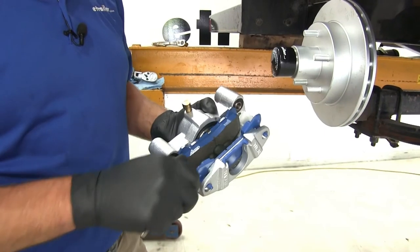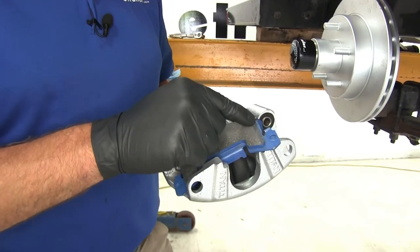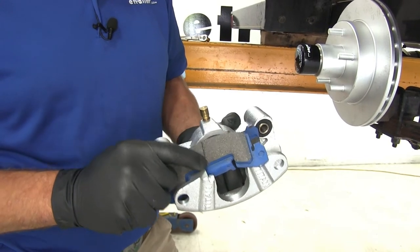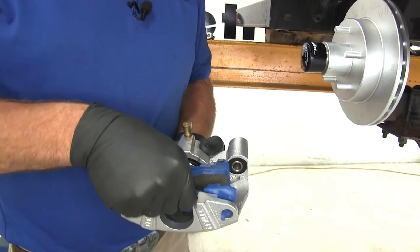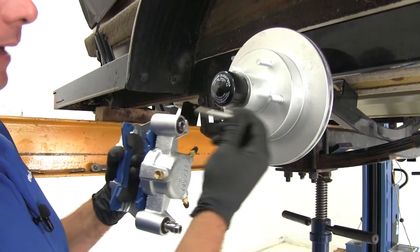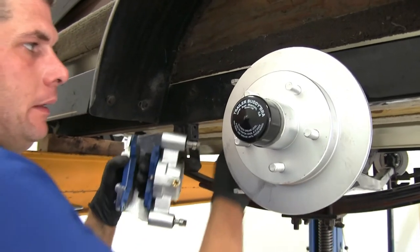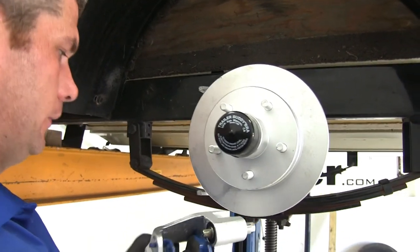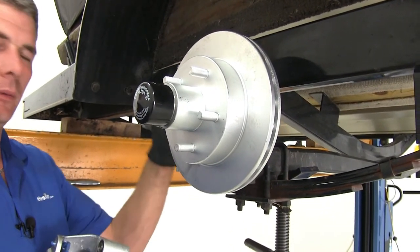Now we'll get our calipers installed. As you can see, they come preloaded with the pads — really nice automotive grade pads with a chamfered edge on each side to help with chatter and noise, and they're slotted to allow dust out. These are ceramic pads, so they give great stopping power. To install the calipers to the brackets using the caliper bolts — depending on your trailer setup, the length between the hole and the frame might not allow you to slide it in, so remove the bottom shackle bolt to lower the axle down a little bit, get the caliper in place, then raise it back into position.